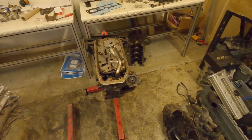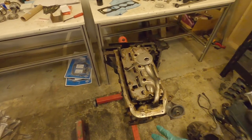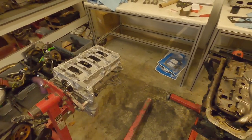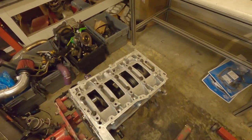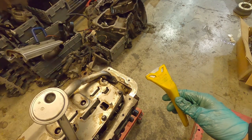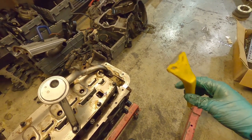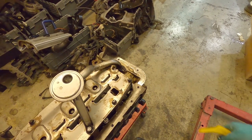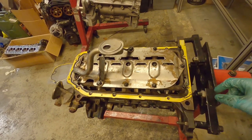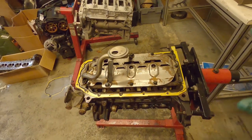The next thing is to put the sump on. This particular engine just uses a gasket. You do see some people silicone these gaskets if they're struggling to get them to seal, but officially you should just make sure the surfaces are flat and clean, and use the gasket only. Some engines don't use gaskets — they use sealant everywhere. If you haven't cleaned your surfaces yet, you can use a little blade at an angle to gently rub over the surface to pick up old silicone or old gaskets. Another way is very fine wet and dry sandpaper. Do whatever your engine recommends. Once surfaces are clean and flat, get your gaskets, position them, and make sure they line up on all the holes — pay attention to orientation, as some gaskets can almost go on upside down.